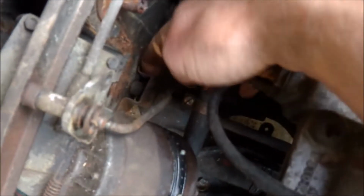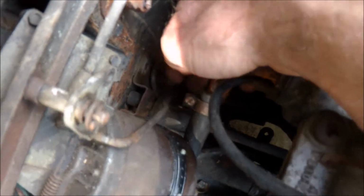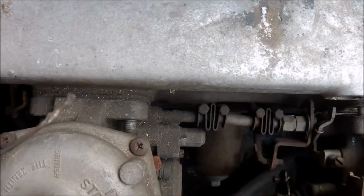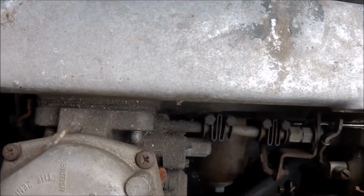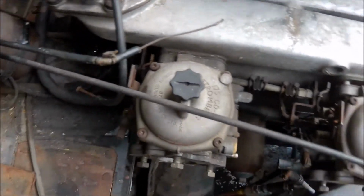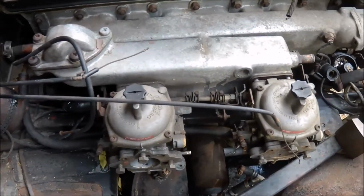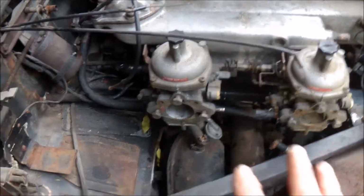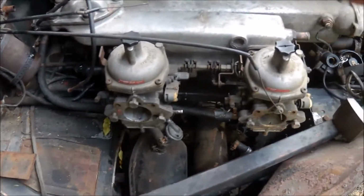Then I realised that I actually have to remove this throttle linkage down here, which I've just unbolted off the firewall. The reason that is, these manifolds got to come right off those studs, and certainly the studs on the top are right out to here, so this has got to pull a long way out. So at this stage that should come off. So the next video you see, you should see that this carburetor is sitting on here, separate from the main manifold.